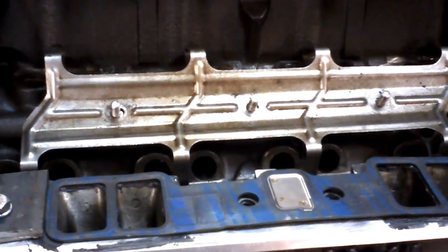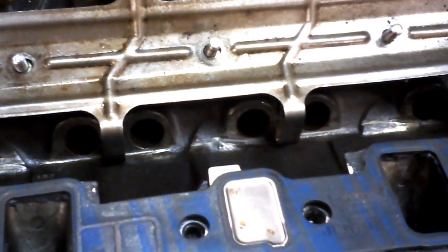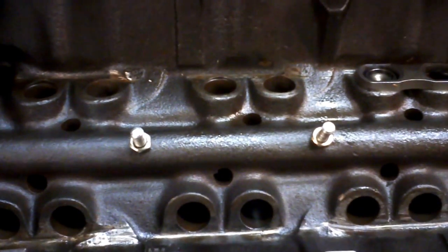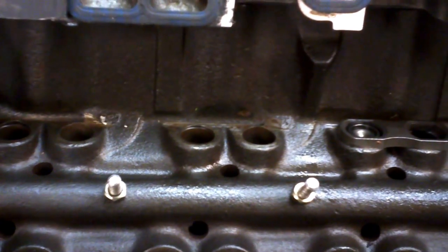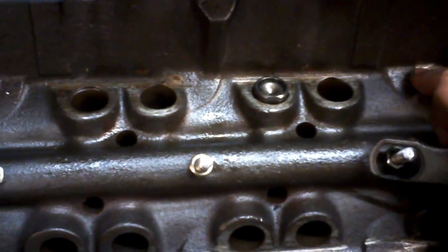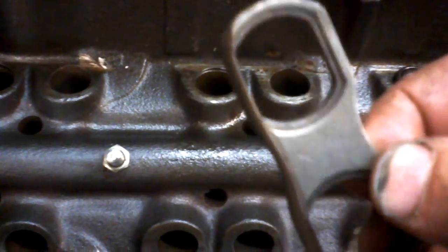It's a little intimidating at first, and I would caution anyone not to grind the block too much. You're much better off taking most of the material out of the dog bones. I had to do a little bit of clearancing on the block in a couple of areas, but it's minimal. Because the valley of this motor — if you get some core shift — can be pretty thin. And if you grind too much, you can definitely get some cracks. Even if you have a good block that doesn't have much core shift, it's not necessary to grind on the block. You just need to do a little bit of clearancing in the corners where the material is actually built up pretty thick, and take most of the material out of the dog bone. That's how you do it.